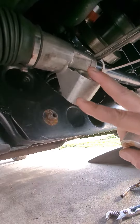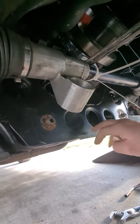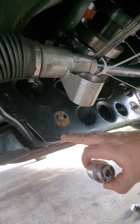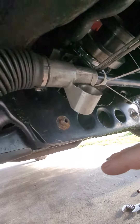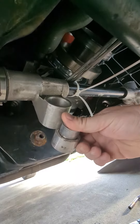I need a new mounting solution for my Mustang 2 rack and pinion that goes on my Chevy C1500 truck. The testing I'm doing is moving this rack all the way flat up against the back of this plate that I made — I can't have this one inch spacer here anymore holding it away from the plate. My theory is pushing this back will give me some better Ackerman. It may not fix it 100%, but it'll improve it. So I need a new mounting solution for this style of rack without a spacer.